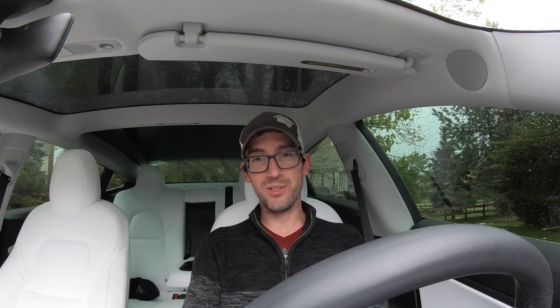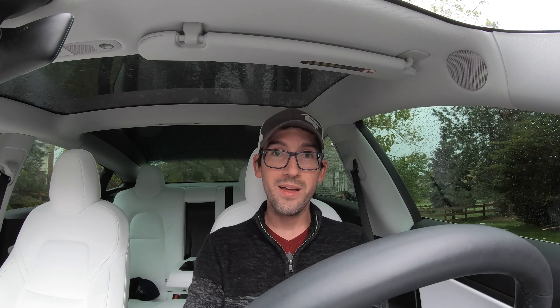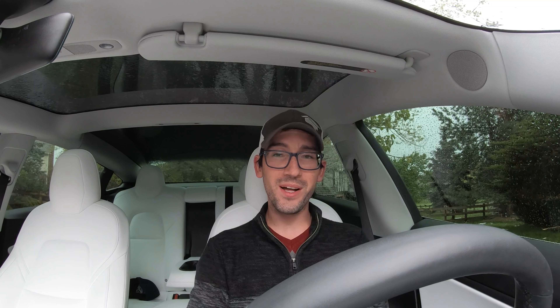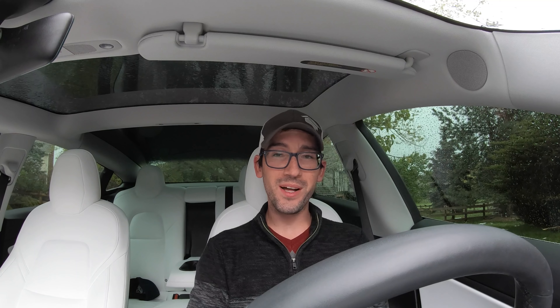Inside of here is where we're mainly going to be working. This is just held in by a couple of clips, so all that's really necessary is just getting your thumbs in here and popping up on it a little bit. There is a wire attached to the button — the trunk release — but this is the spring we're talking about, right in here. We're going to grab some needle nose pliers so we can get this out. It just latches right on to these guys here, so we just grab on and pop this guy off. Now we're going to grab one of these springs — it is a two-pack, so if anybody wants the extra one, definitely send a comment and I'll be happy to send it to you. This should be able to be done by hand; we should be able to just pop it on. And that is on.